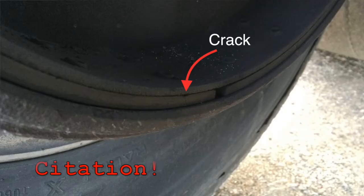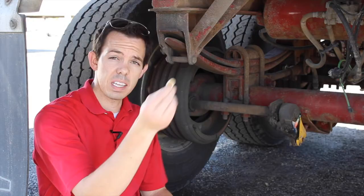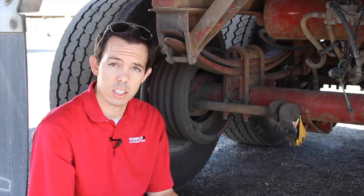While you're checking out your brake system, you're going to want to look at your drums. Sometimes drums get worn out and they get a little lip on the edge. Take a penny, and if you can fit the penny behind that lip and can't see it, your drum needs to be replaced. Also look to see if you have cracked drums or any other concerning issues. You can ask the shop if you have questions.